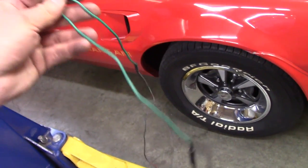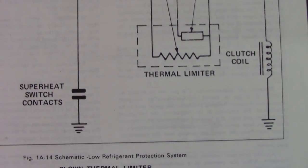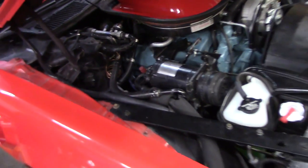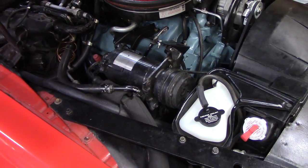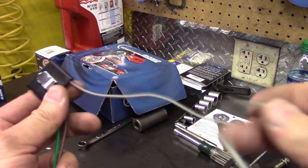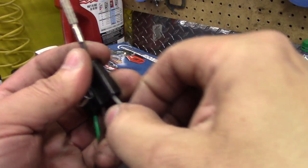I got the instructions for this and it said run the power wire to this and then to your compressor. So we got a new pigtail for the compressor. I noticed it had an extra end on it - that's for the superheat switch. Apparently if that thing grounds out, it blows this thermal limiter - a fuse, I'm going to call it. That would plug into the back of this compressor, but I've searched high and low and I don't see a place to plug it in. So the compressor will work without this superheat safety device on there, and if it burns up, too bad, so sad.